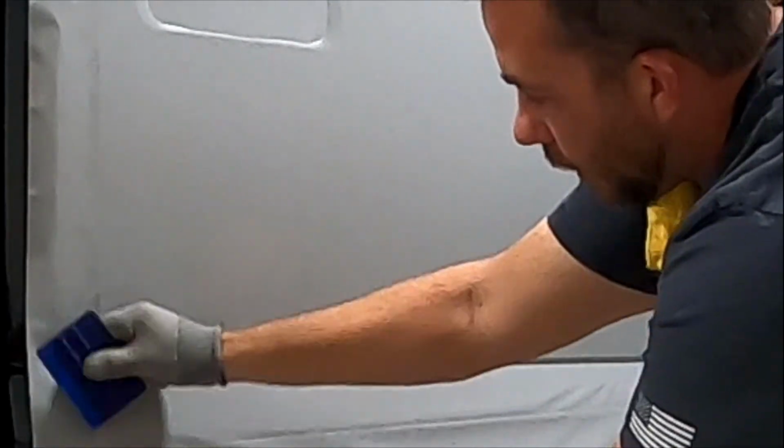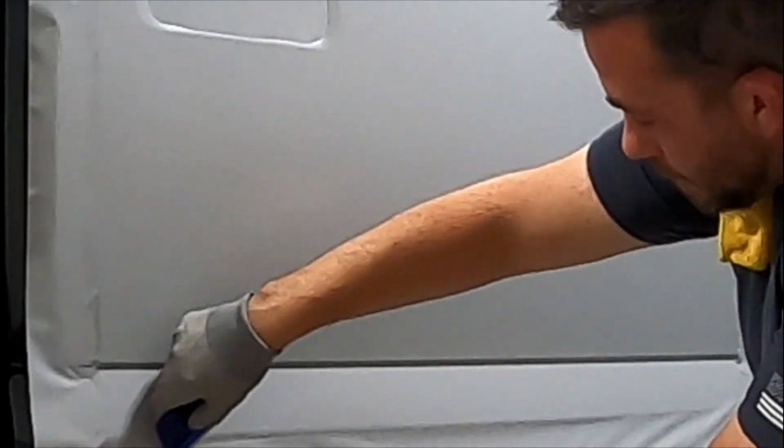So one thing about vinyl is it's made with PVC, so it has memory. And different manufacturers have different temperature sets, but typically it's right around 190 degrees Fahrenheit. You'll have to post-heat vinyl to get rid of the memory in it. And usually at the shop, you got a helper, they'll come behind you after you've laid a panel and go over and spend the time to post-heat the whole panel, make sure everything's down and flawless, reassemble, things like that.